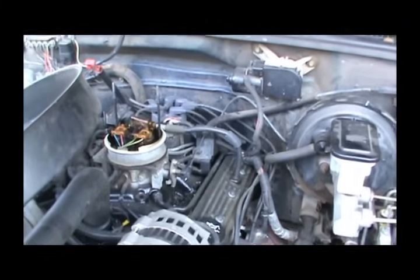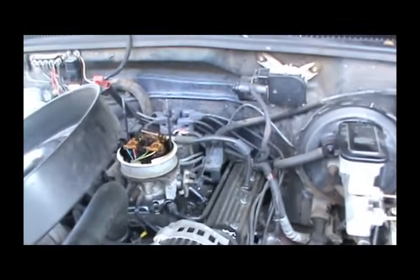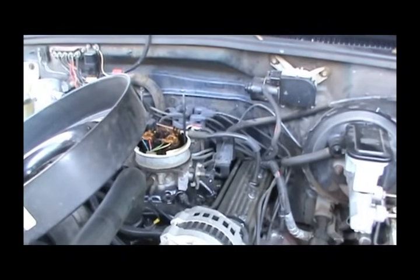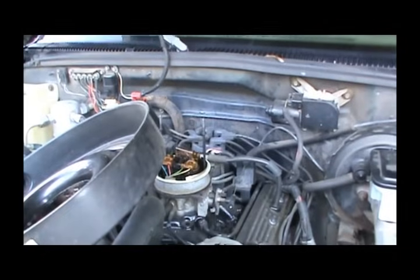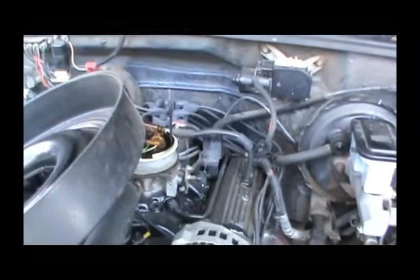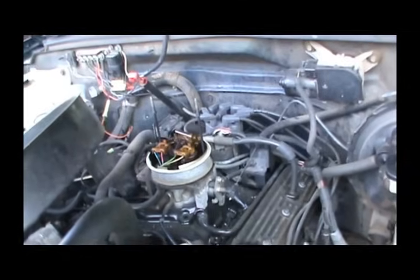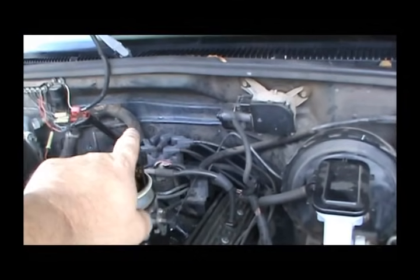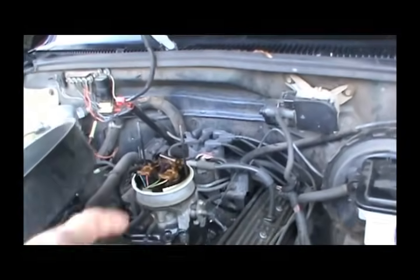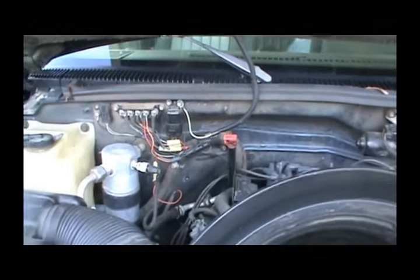I hope this clarifies it up for this guy — I can't remember your name — but I know I've been giving you some advice. Go to Scanner Danner's channel; he's got a very good ignition systems video that shows all the GM, Ford, and Chrysler systems. Now in his video he's talking about a later model that has a crank sensor, which these do not — the 96 and newer do have a crank sensor, but these don't. It's taking a reference from your distributor, it goes to your computer, then the computer sends a reference back and tells your coil when to spark. Hope this helps, and thanks for watching.